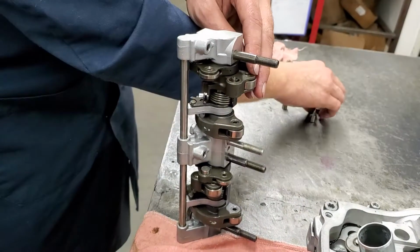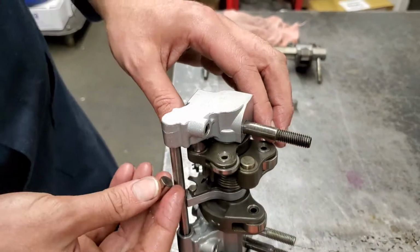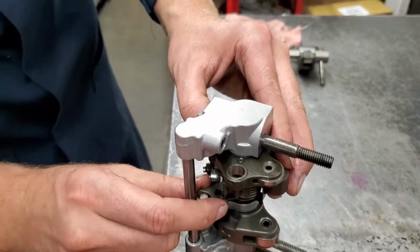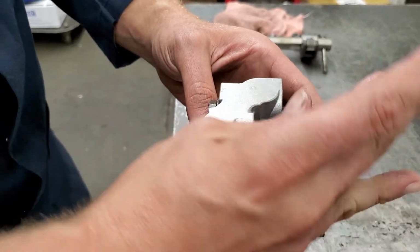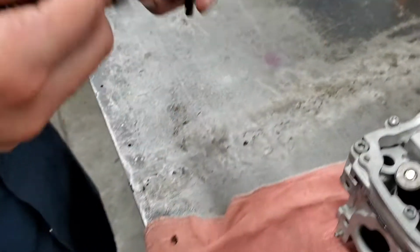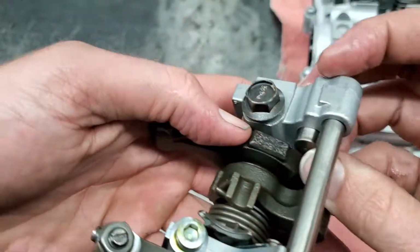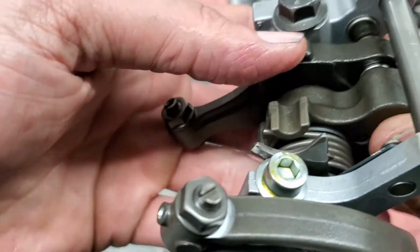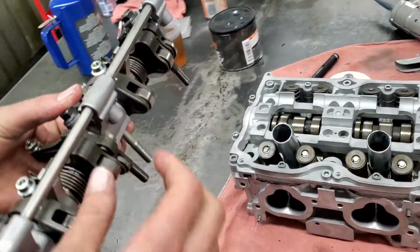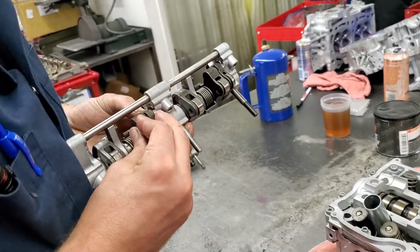Spring goes in there, little cup, and the solid piston there. Right in there. And it goes there. Alrighty. Now those 2 set into place, so just adjust them so it's not going to bind on me when I put the rocker arm assembly down on it.